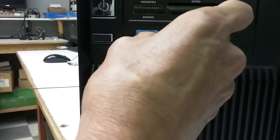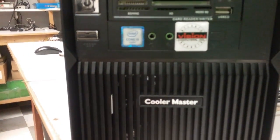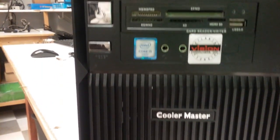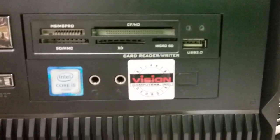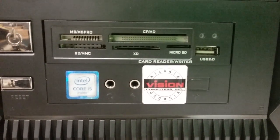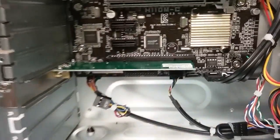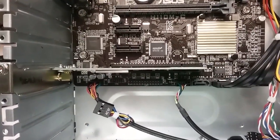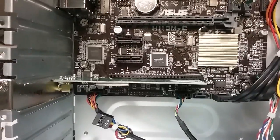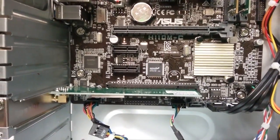In this case, the customer may not have any knowledge that behind these logos there are USB ports that are not functioning. The card reader comes with only and only one USB port, so the customer is going to lose one USB port in front — one USB port with the card reader, and one USB header on the motherboard. This is the information that either a technician or sales rep needs to know for future sales as well as for systems already sold to customers.